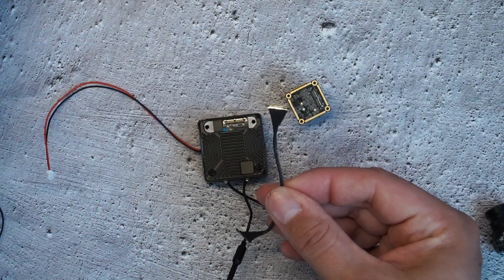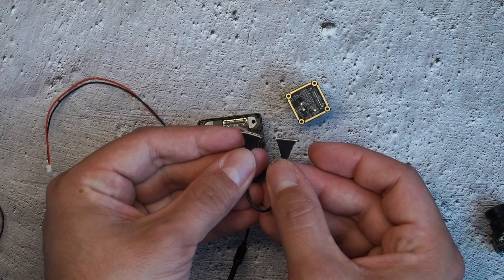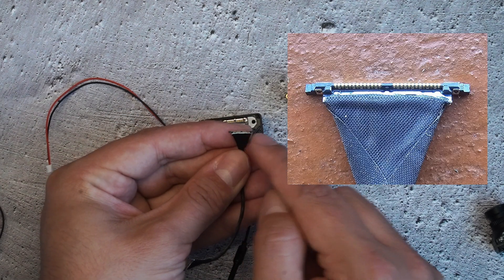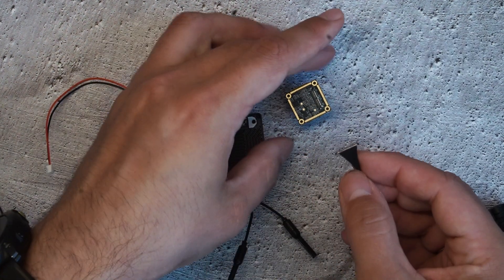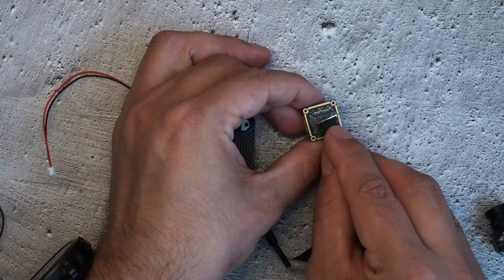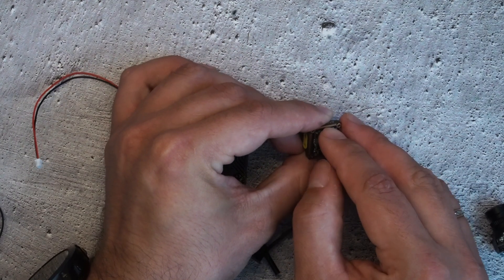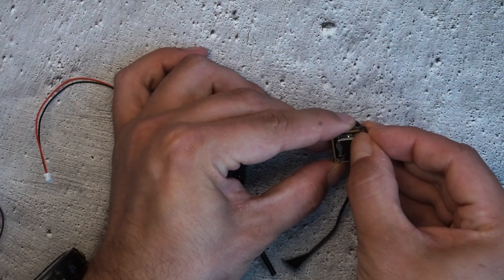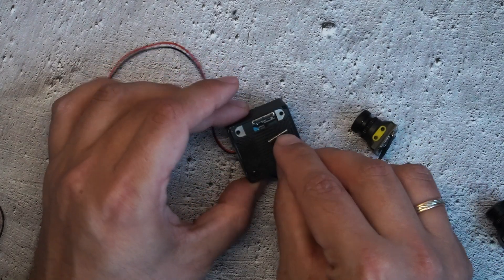Take the new wire — you can see it's identical. Pay attention: this wire is identical on both sides but upside down. From one side you see lots of pins; on the other side just a metal plate. The metal plate goes on the upper side toward you, and the pins go toward the PCB. Connect very carefully without using much force, as you can easily damage the PCB — it's very thin.